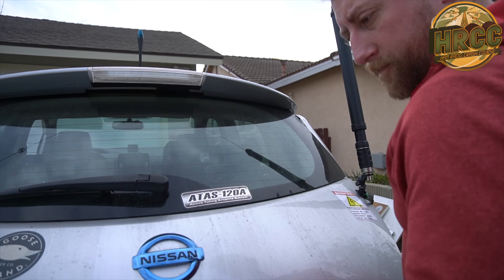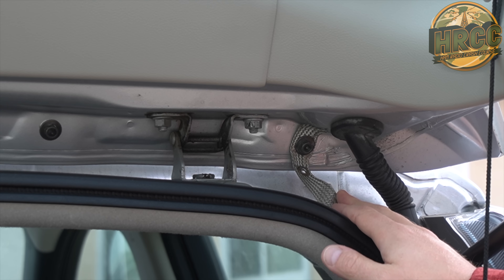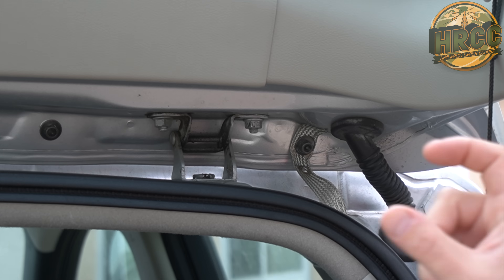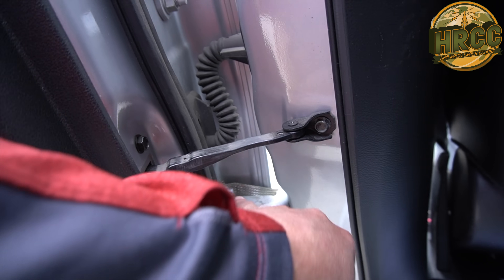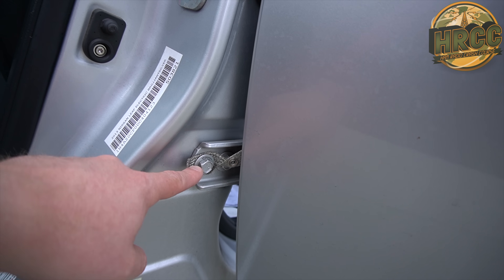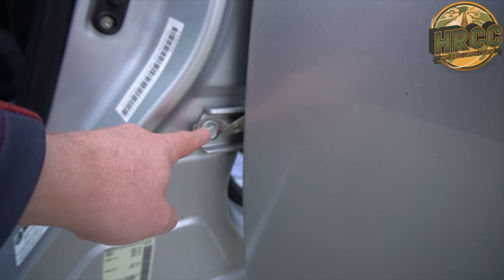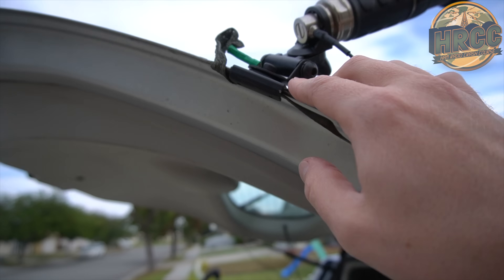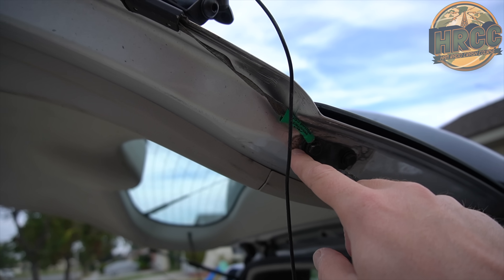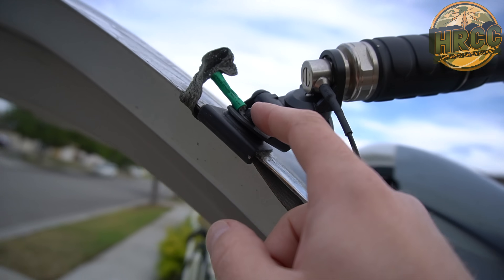So let's walk around the bonding a little bit. The first point of bonding, and the most important, was getting a connection from the hatch to the body of the car. I did that on both sides with appreciably wide ground strap. Then on each door I did the same thing — bonding to the hinge and then bonding it to the body with ground strap. Basically, what you need to know is on the side of the strap that goes against the body of the car, you want to use a serrated locking washer — very important to have that. From a recommendation from Bob at HRO, he said take your ground strap, mount it — I did have to grind the paint a little bit before I learned about the serrated lock washers — connect that up, then go underneath the mount, come out, and make a solid connection right there.